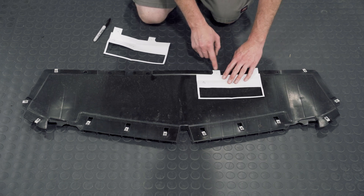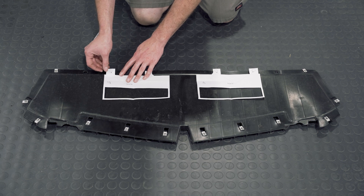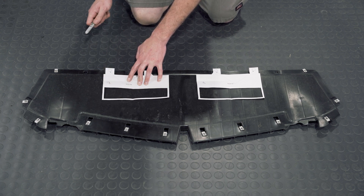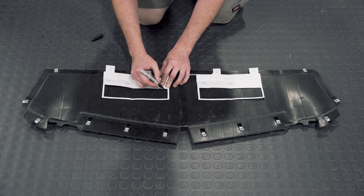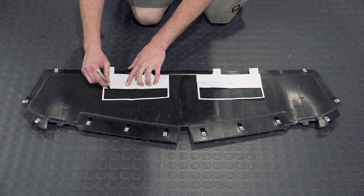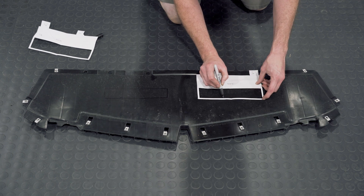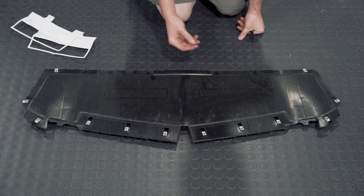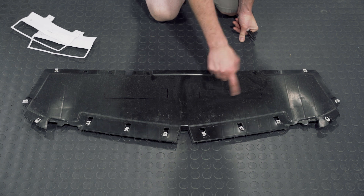On the templates, you've got this small raised-up portion in the center that's going to line up with our templates on both sides. You're going to line these little ovals up with approximately where those holes are, and then we're actually going to cut out this portion here. I'm just going to take a marker and draw a line — you can tape these down too if you'd like. We've got them marked out; you can use whatever method of choice to cut these out. I have a body saw or a small sawzall, so I'll drill a hole and cut them out with that. Just keep in mind, you have ribbing on the backside that you will have to cut through as well.